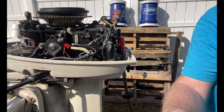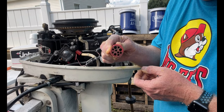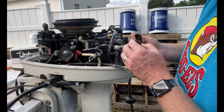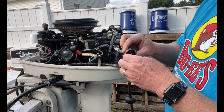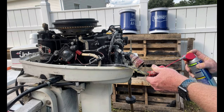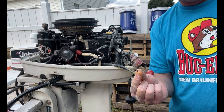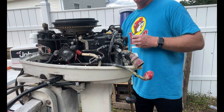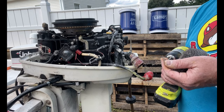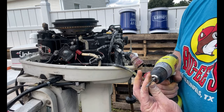Let it sit for a little bit. As you can see it's not exactly all gone. We can see still some corrosion down in there — we want this clean. We can also see that pin right there is just green still. So what we need to do now is maybe file this a little bit — not with sandpaper, because we don't want to remove material — but we do want to clean this up.